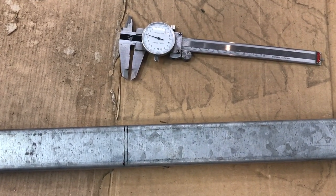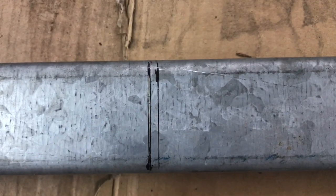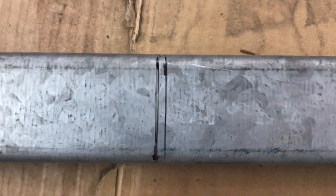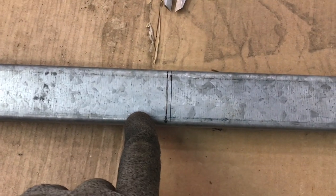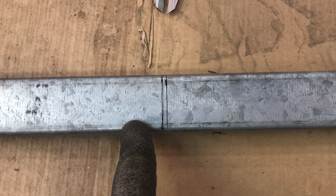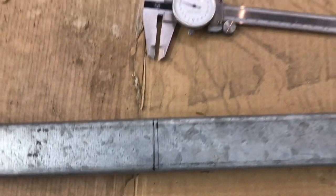I just did all of that again because I felt the lines on the tyres weren't really that accurate. So what I did was put some tape on the tyres and, as you can see, it's far more accurate. The measurements show a difference of 3.6 millimetres between the front and the back, and that should be two. So it's 1.6 millimetres out, essentially. What I need to do is bring both sides in 0.8 of a millimetre just to close that gap.